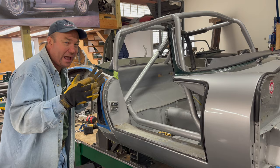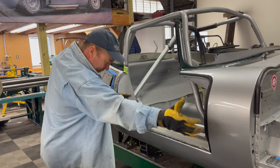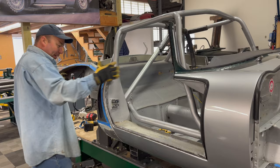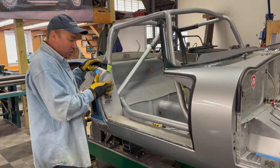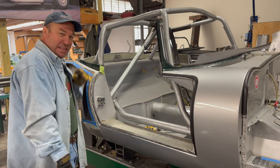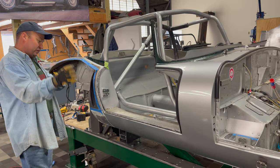What I'm doing is first getting rid of all the wrinkled stuff that has to go anyway, then I'm down to a much smaller structure that'll be easier to move. After I get this sill off and start trimming things up, we should be able to pull this back into place — not by hand, but probably with a couple of ratchet straps. It seems to be only out by about a quarter inch at most. You get a lot of wrinkling from very little movement — this thing might be pushed forward less than an eighth of an inch but you've got that big wrinkle.